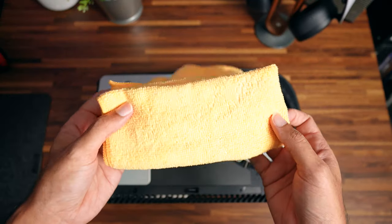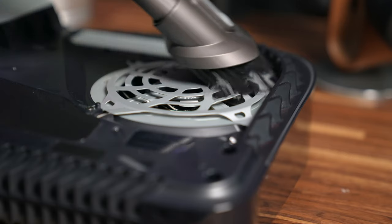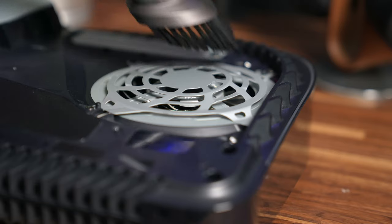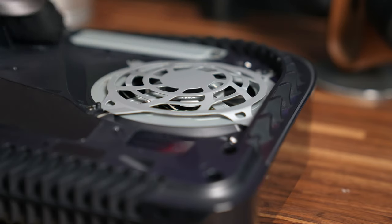While we have the plates off let's go ahead and remove any dust that might have built up over time. First I'll take a microfiber cloth and wipe away any loose dust or dirt. Next I'll take my vacuum and mostly use it around the fan to pull away any loose dust — I'm not pressing hard against the console or trying to make the fan spin, just lightly running the bristles over the area to pull away any loose particles. Let me know in the comment section how you guys clean your tech.